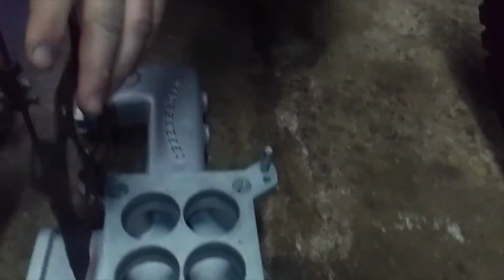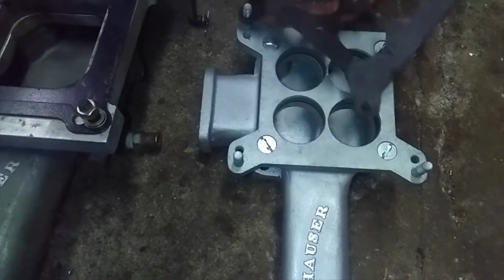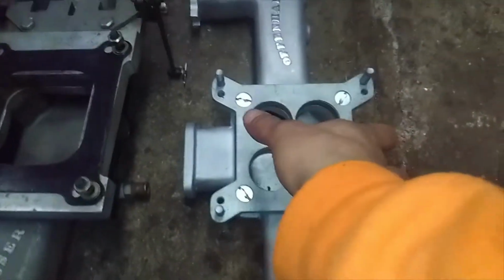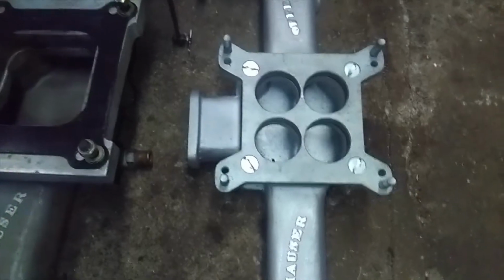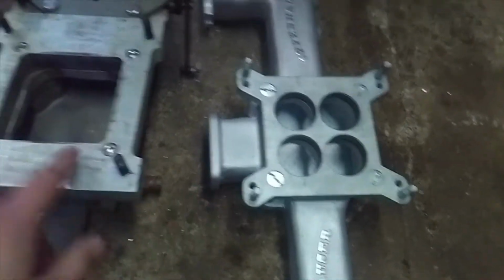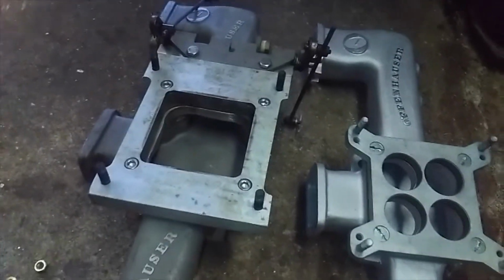Okay. Yeah, because what happened was, when I went to take this and turn it sideways, 90 degrees, to bolt up, the bolt holes didn't line up anymore. They weren't actually in a square. Nope, they're not. So yeah, we didn't even use the holes that were in the manifold. I had Vito totally weld in the holes, and I re-drilled and tapped them.